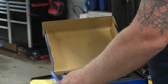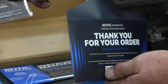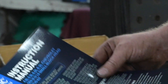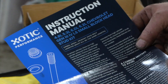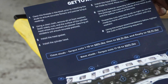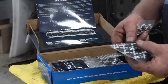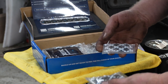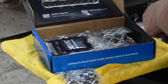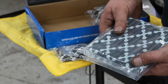This is a complete kit — it will do everything you need. Comes with a little thank you pack: a sticker, an air freshener, and a warranty registration card — you want to keep that in case you have trouble. Comes with real nice laminated instructions; take your time and read through them, pick up all the little tips, common mistakes, torque pattern, and torque specs. This kit includes little baby studs for the inner row bolt as well. You've got your baby studs and baby nuts, the proper 12-point sockets, installation lubricant, and your cylinder head studs — all the same length, nothing to watch out for there.